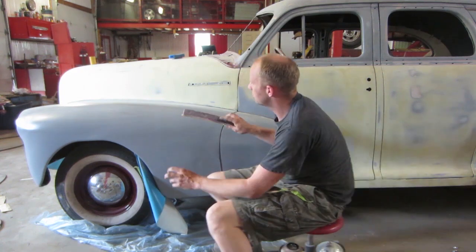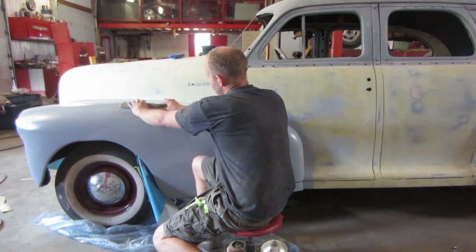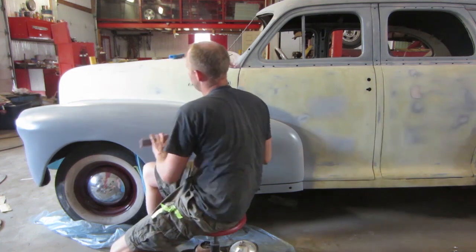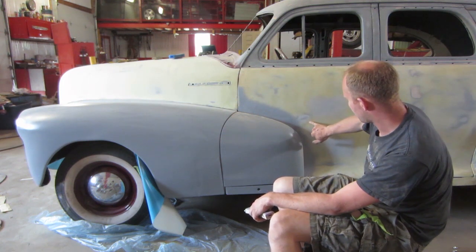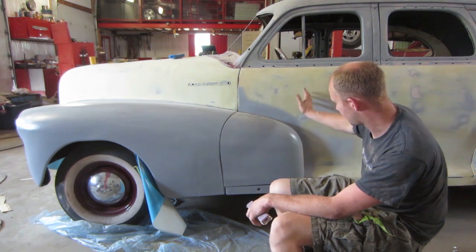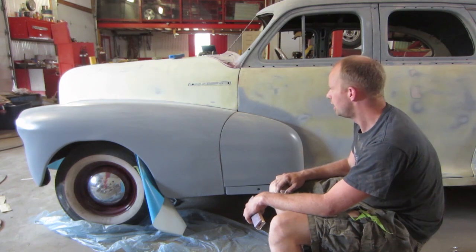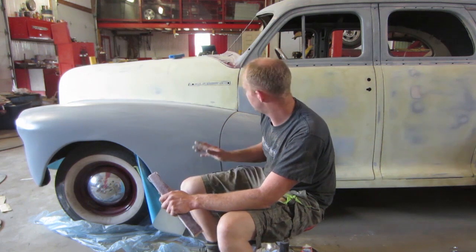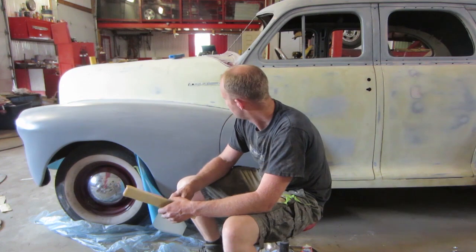When you're sanding, make sure you're going on an angle and you don't stay in one spot. So an X pattern is good. And then just work your way along. And then you'll find your high spots and your low spots. Your high spots will come up first. You can see the Bondo and then the primer, the fill primer and then the epoxy. And that's fine, you know where your high spots are, whether you gotta knock those down again or whatnot. You can fix your gaps slightly, you can't do too much with it, but you can gain or lose a 1/16 of an inch or less.